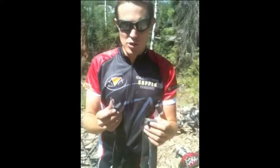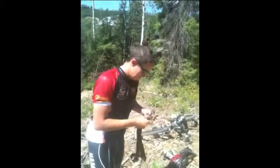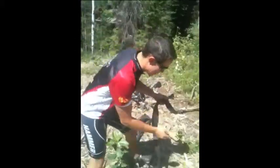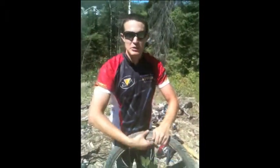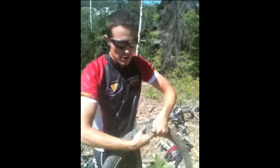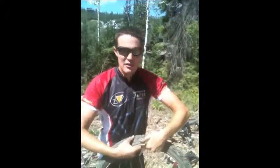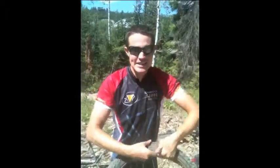Alright, because our pump will do either, we're going to try the Presta. The important thing to remember is, it's possible that you had two punctures or two flats at the same time. So you've got to run your hand through the inside of the tire all the way around to make sure you don't have thorns in there. If you still have a thorn sticking through your tire and you pump it back up, you've just popped your second tube.